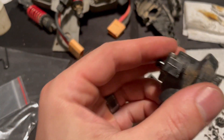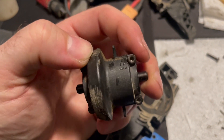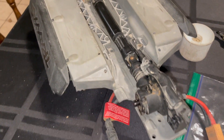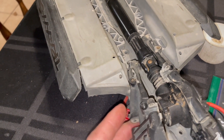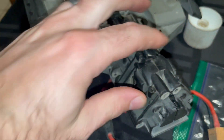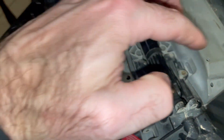And then we're going to get that put into the bulkhead, and the bulkhead onto the car in that orientation. It's kind of hard to do one-handed, but this has an upside — and it even says it's for the Revo, so that side goes up and it'll sit in there. When putting this back together, it's easiest if you do one side of the bulkhead in, then add the grub screw for your drive shaft, and then you can just slide the other piece in. There's a tiny little screw that goes in this side right there to hold those two halves together, and the front half is held together by the main part of the chassis.